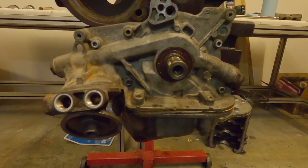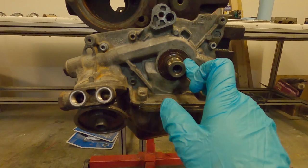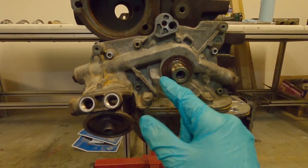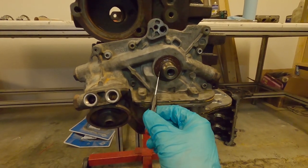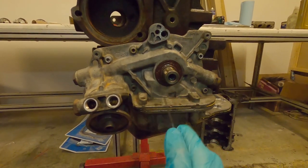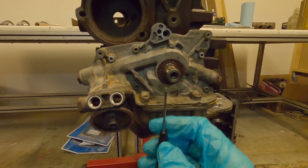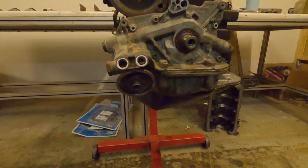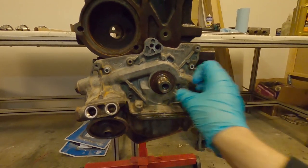Our seal's in — it was particularly tight to hook over the crank. What you have to do is use a very blunt, tiny screwdriver to persuade the last little bits over the crank, to ensure the spring wouldn't pop off and you wouldn't push the seal too far on one side and not enough on the other. Just hook it from either side over the crank with a blunt screwdriver — not a pick. Be very careful not to puncture the seal or do any damage to it. Once it's mostly on, use the old seal on top, your socket and your mallet, and just tap it in. Make sure it's nice and flush where it's supposed to sit.